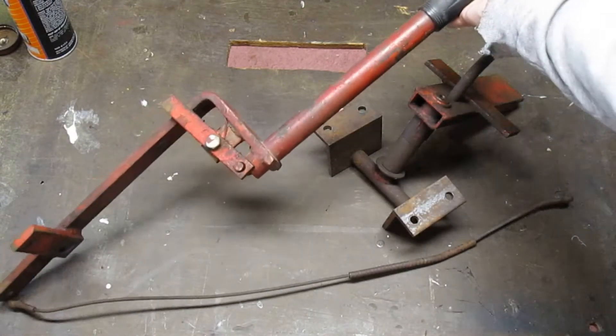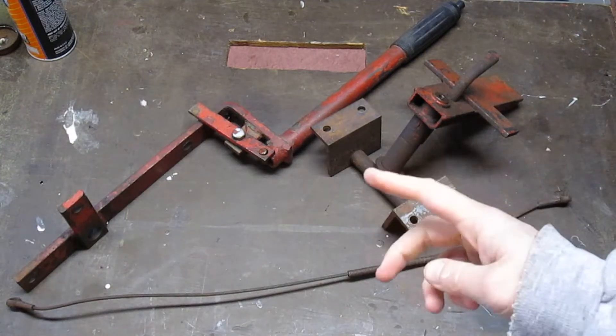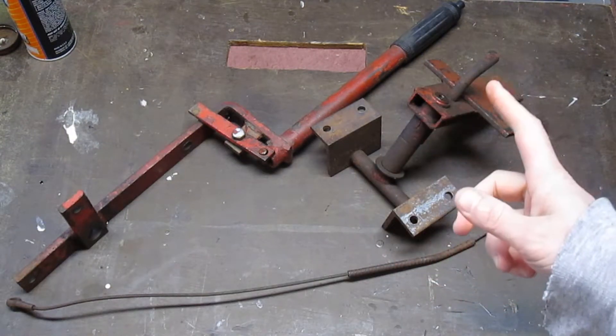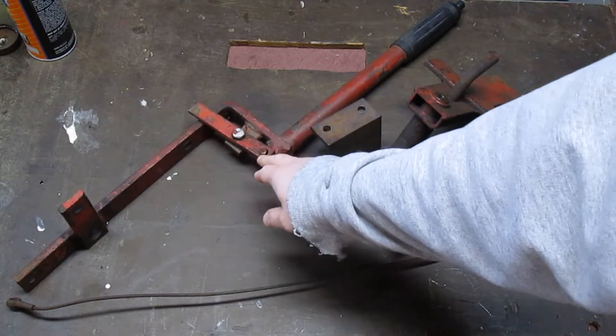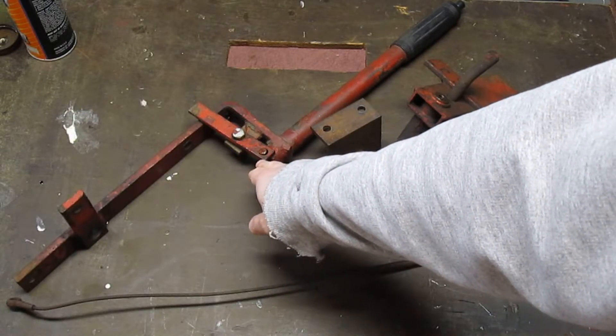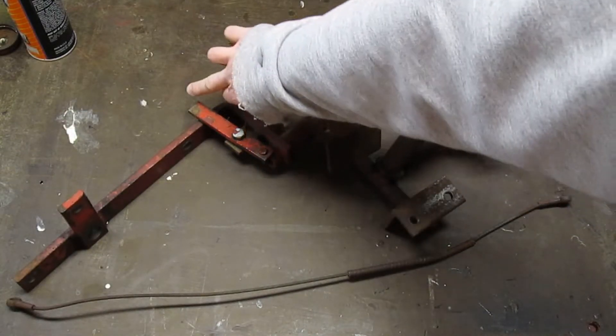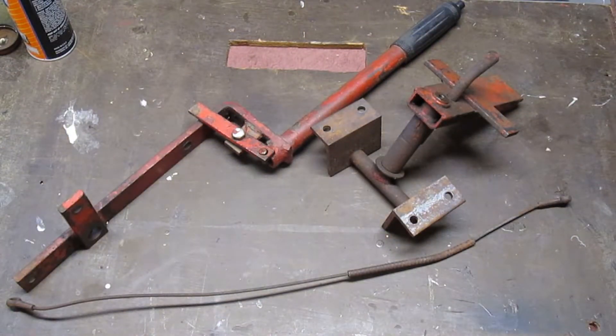One way to tell the difference between an RJ-35 lift arm and an RJ-58 or RJ-59: the RJ-35 had square corners on the lock lever, compared to the 58 and 59 where the corners are rounded off in that area. This also carried over into the Suburbans, the 1960 and 1961 models.